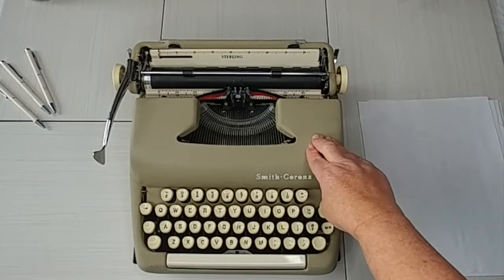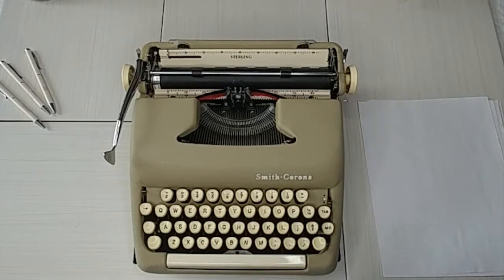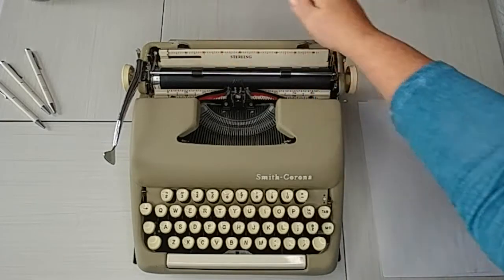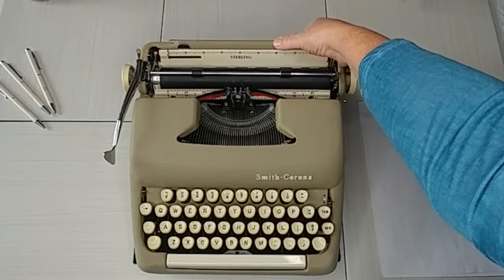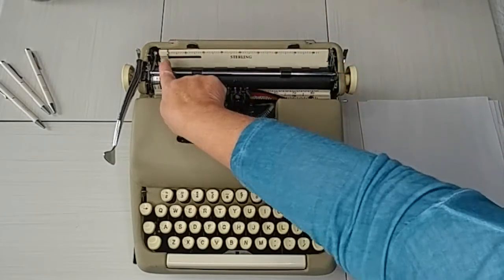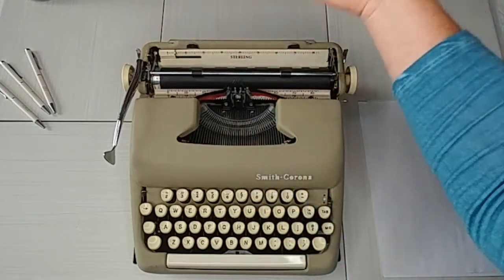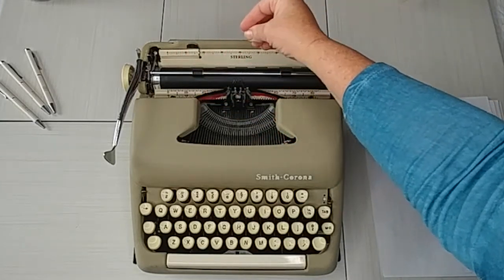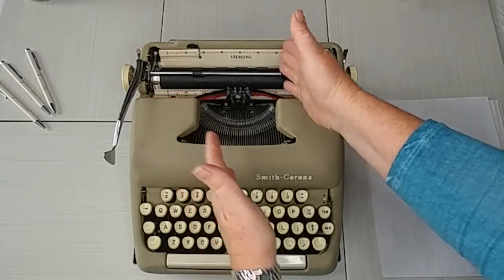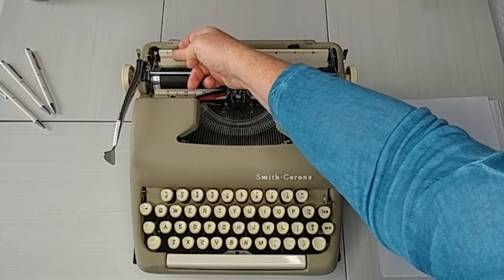This is the original color — it's a beige — and it's all manual. These are really good typewriters. Right here is your paper holder. To set your margins, press down on the two metal tabs and drag them where you want. This is a paper guide, which helps you insert your paper consistently in the same place every time. You can bring it all the way in if you're doing something like a postcard and want to keep your carriage somewhat centered for smaller paper.